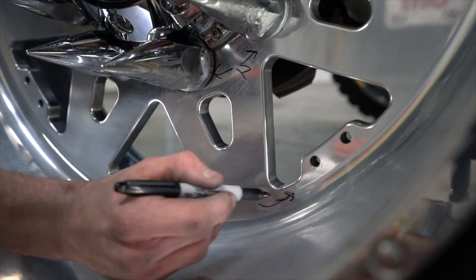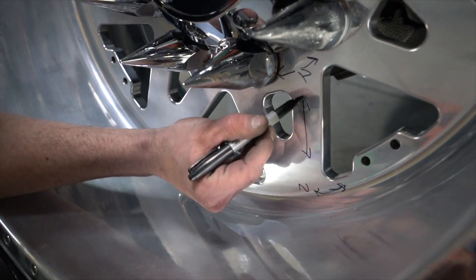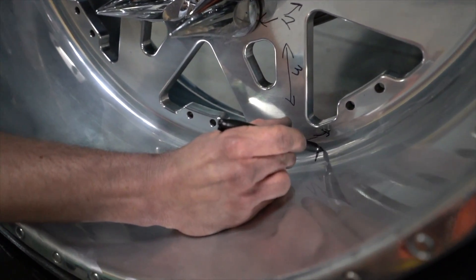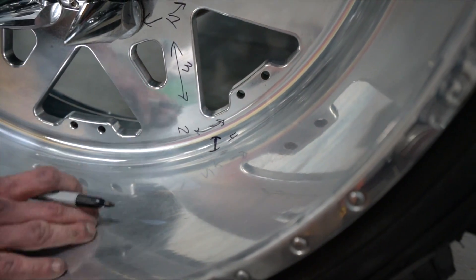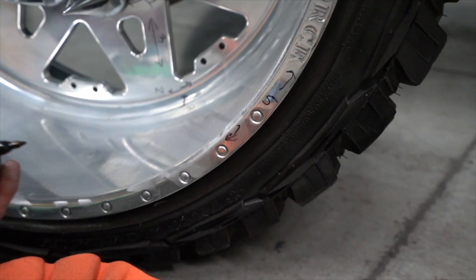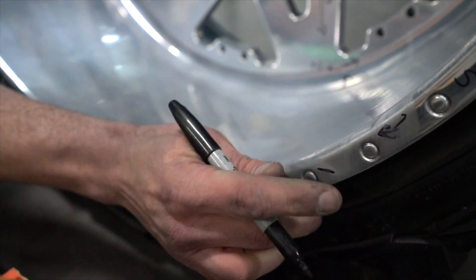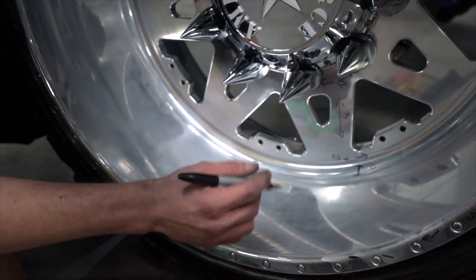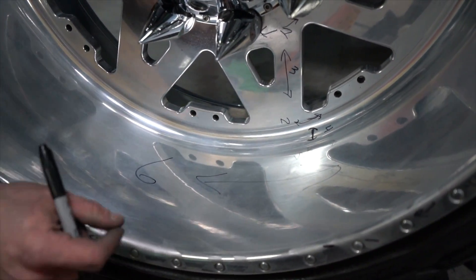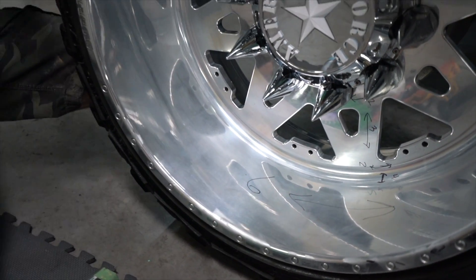Then you want to skip to this water tray right here — that'll be number two. After that, come back to your flat section after you've already outlined — and this is three. So all this section is going to be done, you come in here, do your little bit of water tray all the way out — that's four. You want to skip your big flat surface and come all the way to your lip — all your lip all the way around is going to be your five. If you take your pen and scratch in some of these scratches, you can sand that all the way down until the sharpie's gone, and that'll tell you exactly when it's even. When you come back to do your big section, this side here is number six — it's your most important section. Real smooth, even, line to line, so you don't have to slow down and leave little notches. You want a big section right in the middle before you move on to your next step.